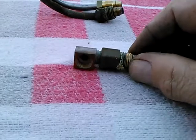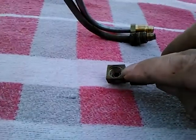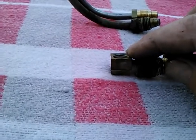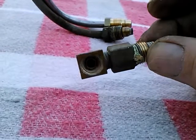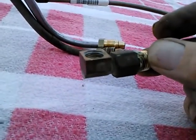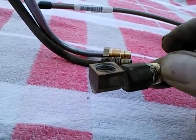It's a combination of a flare fitting to pipe thread and then pipe thread back to flare. So my fuel line came into here with the flare nut connection, and I just turned the whole assembly. I seated this in the fuel pump and by precision tightening I pointed this straight up.